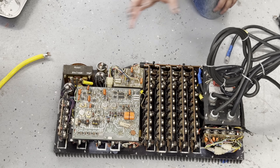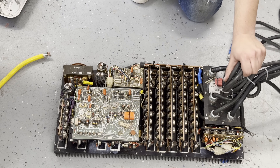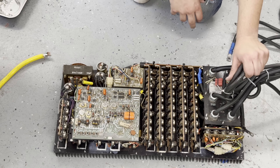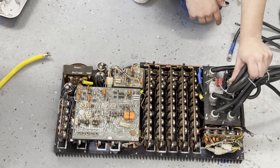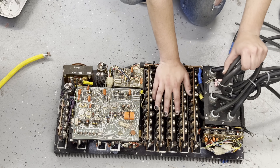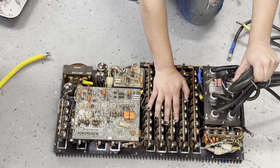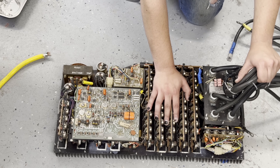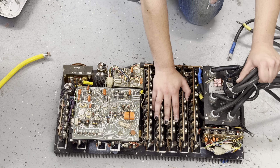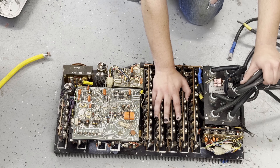This is the controller for the Electrek — specifically this is the 500 amp one, which means it's a little bit sportier than the one in my panel van. However, I have good reason to believe that this one doesn't work, for one reason or another. There's something wrong with the field driving circuit over here and I've yet to be able to diagnose it. But I do want to install this into the car so at least it looks complete, and I'll explain why later.